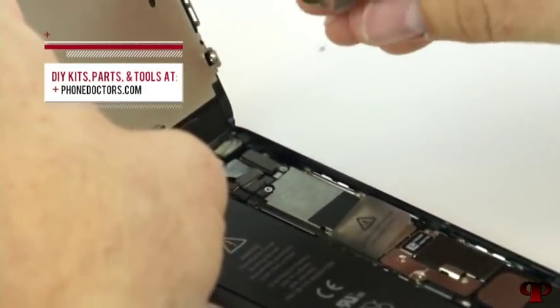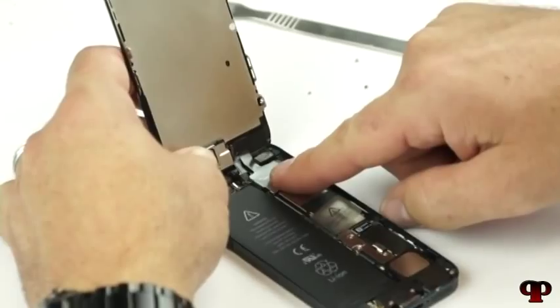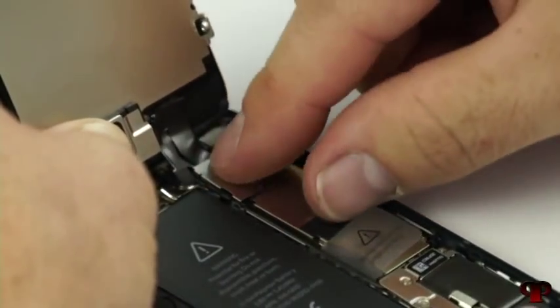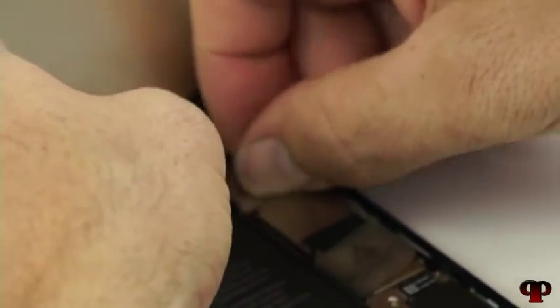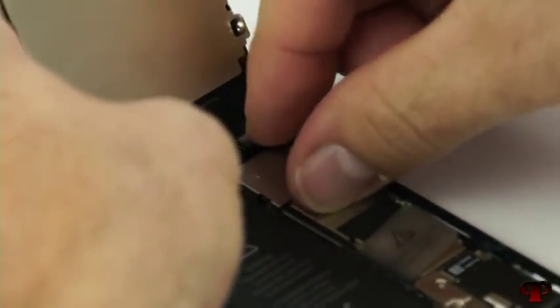Now this little metal shield has a couple of sharp grooves here, and we have cables over here, so we want to be careful that we don't pinch any cables. We just want to line it up over the holes so we can thread these screws nice and easy. It's so nice that you don't have to take everything out to replace the LCD on this iPhone 5 like the iPhone 4 — definitely saves some time. Being careful here because I don't want to rip any cables. Okay, that's still not lined up — there we go, that's what we want.